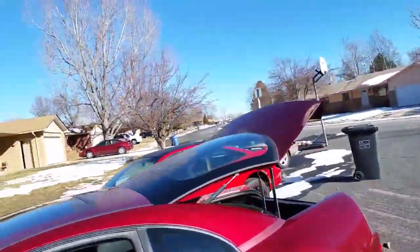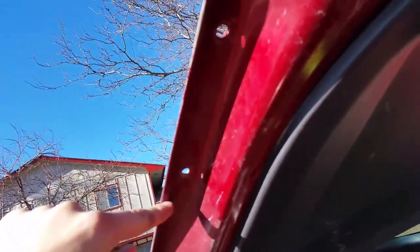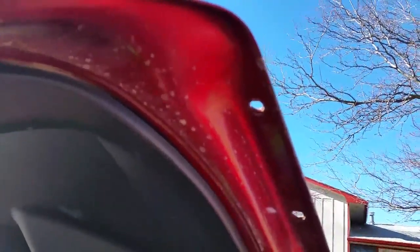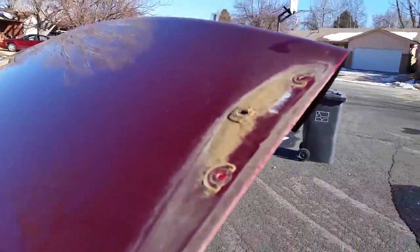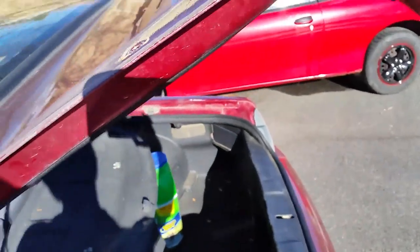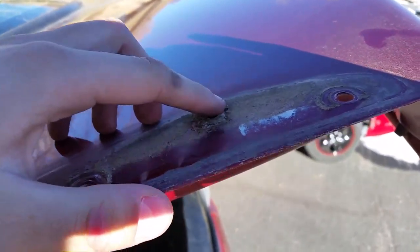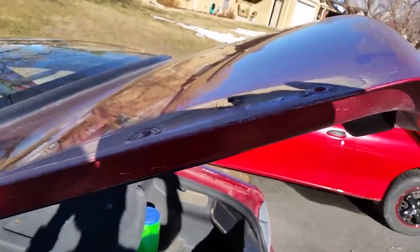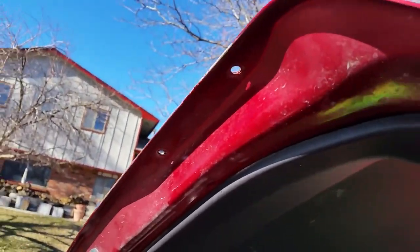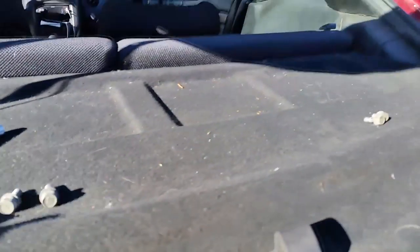Here's the old spoiler — take note there's a clip here and here. My trunk is a little bit up because my struts don't hold it up very well. There's gonna be a bolt hole on each side, and that is where your spoiler sits. Mine had a lot of dirt and crap under it when I pulled it off. You're gonna take these two bolts out — it'll still stay in place because there are clips. This little hole here and that one over there — those clips are really easy, you just lift up on the spoiler and they'll pop right out. You're gonna need a 10 millimeter socket to get those bolts off.